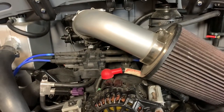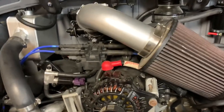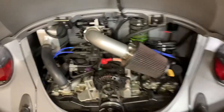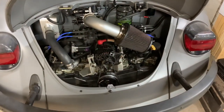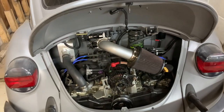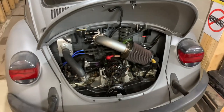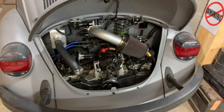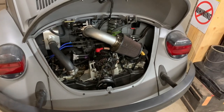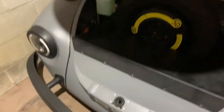I've run this a lot this summer — not sure how many kilometers or miles I've put on it but it's never overheated, no heating issues whatsoever. It stays at around 180°F. On the highway it goes up a little bit, probably to about 185, and when I'm stuck in traffic the fans kick on once in a while in stop-and-go with really warm weather.